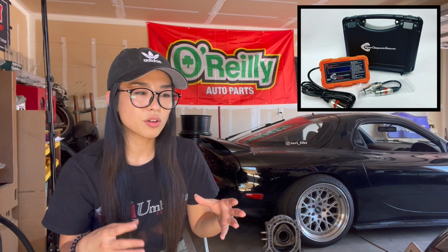There are many issues that lead to this, but the best way to understand the condition of your engine is to get a compression test before you buy it. Rotary engines require a specific compression tester. I think rotary shops and some of the mass dealerships may have access to one. So do yourself a favor and get a compression test done annually. Better to know before your engine blows up, right?